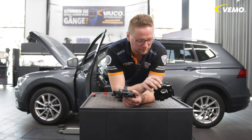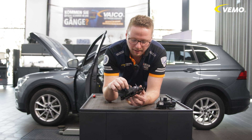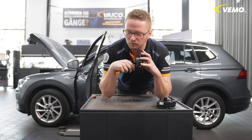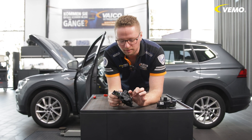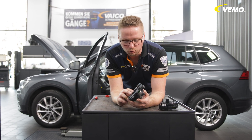We have just removed the coil spring. You can't hear anything, but it's definitely broken. We have another old spring here and you can really hear the defect — it cracks loudly during rotation. It makes a clear noise and you can tell that the conductor track in the housing is broken. With this one, the horn was permanently on — unfavorable for the driver.